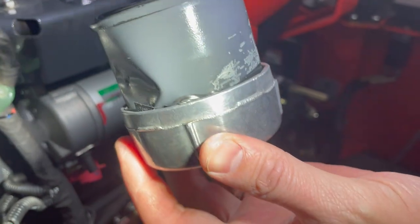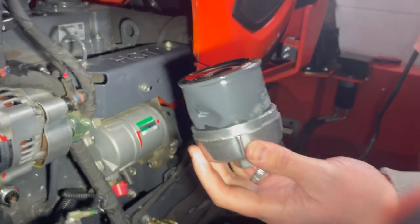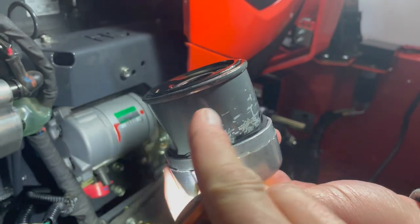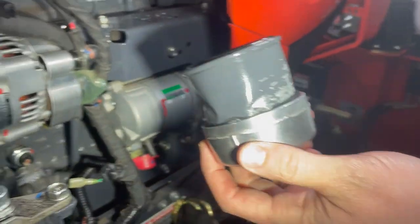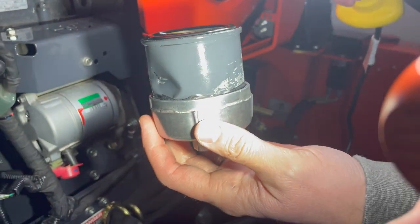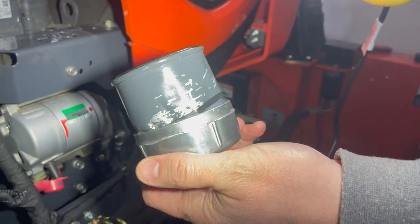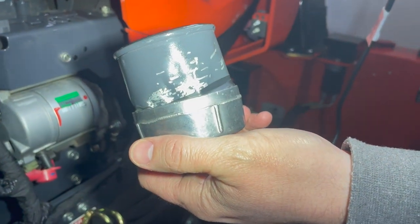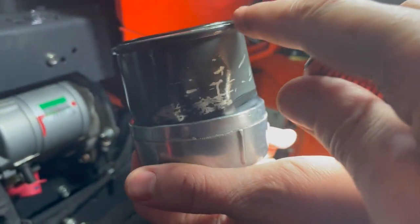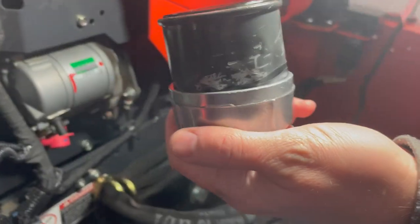As you can see, we wrapped electrical tape around it because we needed to increase the friction. One of the biggest reasons it did not come off is because this filter is gray — the same color as the engine. This is the 50-hour service, changing oil just like you're supposed to. The biggest problem was it was factory installed, which means they painted right over the oil filter. We broke the paint with a pick tool.